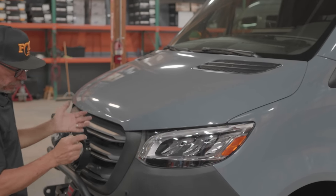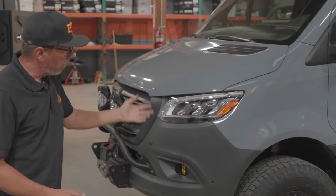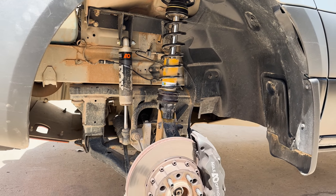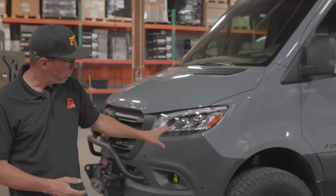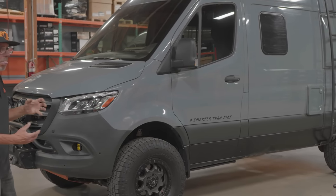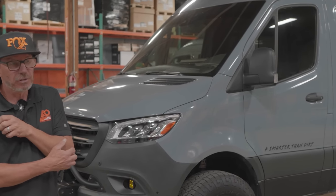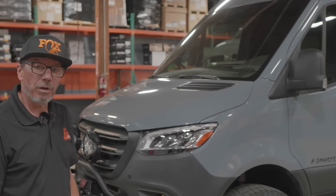This has our RIP kit on it. What the RIP kit does is add additional spring force over the factory strut — in this case I've got Bilstein struts, and they work really well. You're going to get the best bang for your buck running a strut over an auxiliary shock, although we do have our auxiliary shocks on this as well. This is our newest design with a really nice billet lower mount. We're stroking that shock almost a full five inches, which is key — a bitching shock setup doesn't help if it's barely moving.